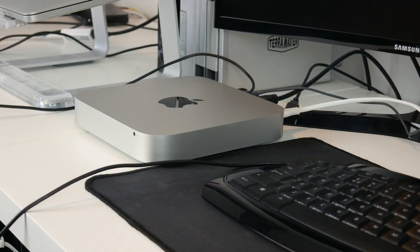It's now been about a week since I installed the SSD into this Mac Mini, and so far it has been running very nicely. It is of course a lot quicker with the SSD in it, and also it's not as noisy because there isn't a hard drive spinning. One thing I have done is enable TRIM — whenever you put an SSD into a Mac device and it's not the SSD it originally came with, it's always important to enable TRIM. I did this in Terminal by simply typing 'sudo trimforce enable', then entering my password, and it restarts and enables TRIM.